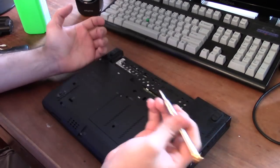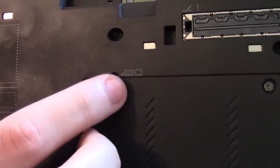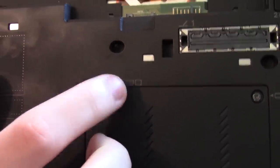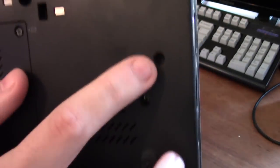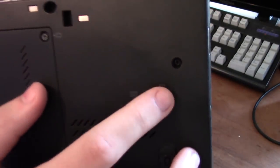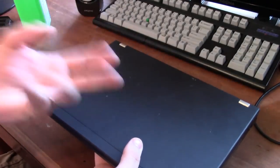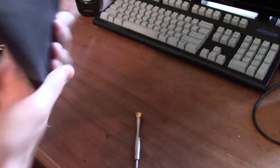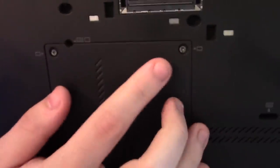In this video, however, we're going to be removing a little bit more. On a ThinkPad you have these little symbols — a little keyboard icon and a little palm rest icon. You want to unscrew all of those, but we're also going to be unscrewing some unmarked ones, because in order to get to the CPU, we actually have to entirely remove the motherboard and flip it over. You don't have to remove the screws for the RAM covering — that will come off with everything else.